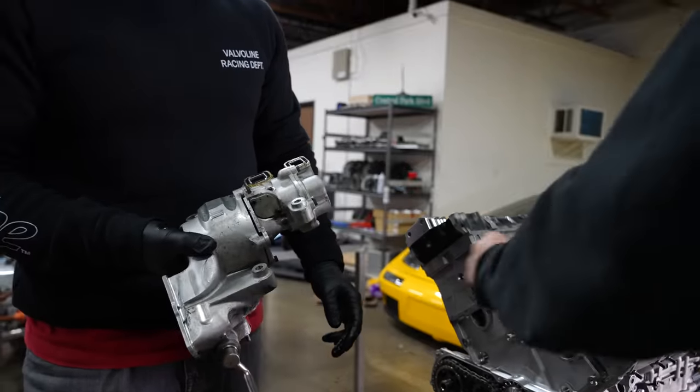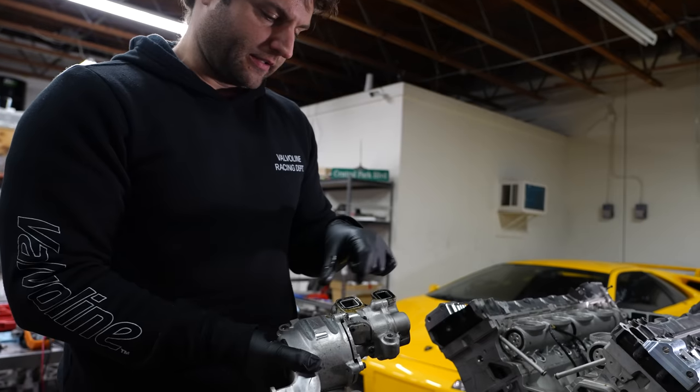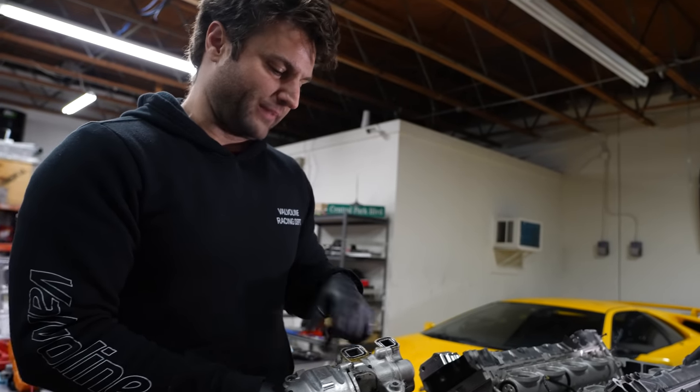Because this goes up to the top to the filter and then distributes the rest of the way. So then oil in — there must be an internal regulator that bypasses it back to the inlet. This comes from the bottom of the sump, which is the lowest part right here.